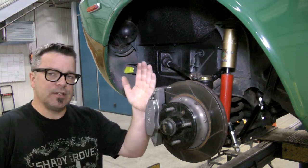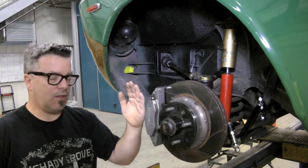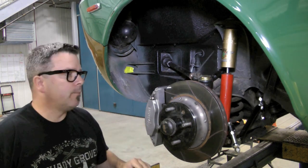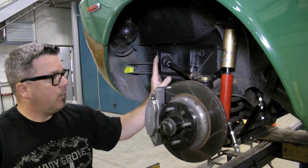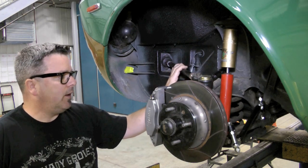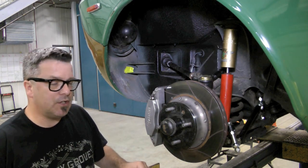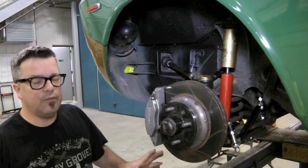The car's characteristics change when on a jack because the wheel naturally swings due to the arms dropping down. Once it sits back on the ground, it still has probably a little bit of positive camber - that's why you have to move the car back and forth to get the wheel to kick back in and be relaxed to where it would normally be on the road. We're going to replace the camber arm on the other side since we now have two brand new ones, and target 1.25 degrees of negative camber.